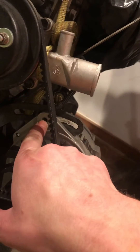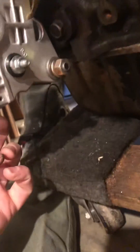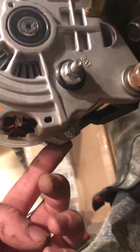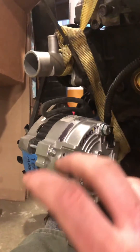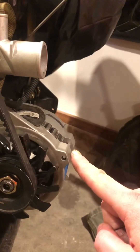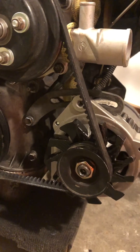One other thing — when you first get this alternator, you do have to take it apart. Undo the three bolts that hold the cases together — one here, one back there, and one on the bottom — and then rotate the case one direction and put everything back together. If you don't do that, the tensioner hole ends up way off to the side where it's worthless. That's it — happy wrenching everybody!